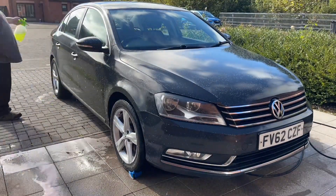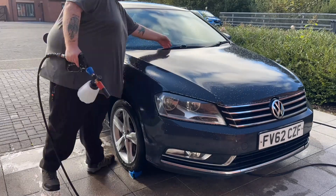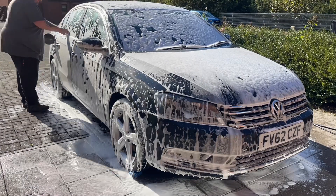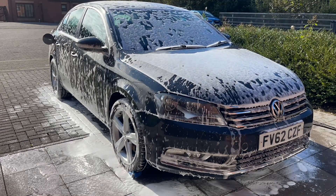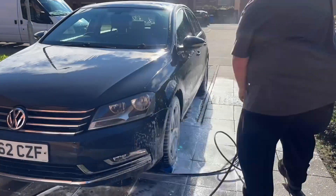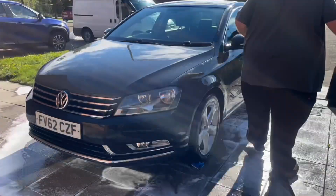Okay, so pre-wash time — it's the iDetail Pro pre-wash spray. Diluted that down with what I had left in the bottle and sprayed it on the car. Because it was getting kind of warm at this point, I thought it best to go on with the Snow Foam, which is the Infinity Wax Power Foam mixed at 100 to 1. Then I went round with a bottle of all-purpose cleaner getting into all those little nooks and crannies, trying to get out as much of that moss and dirt as possible. This Snow Foam was amazing — I used next to nothing in the bottle and it just kept going. Had to dial it way back and it still came out pretty, pretty thick.